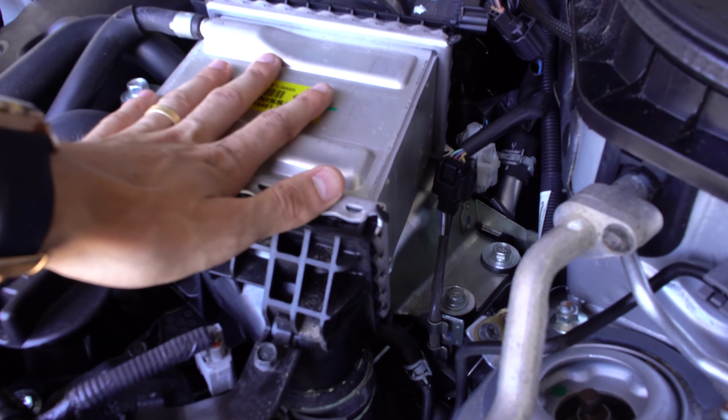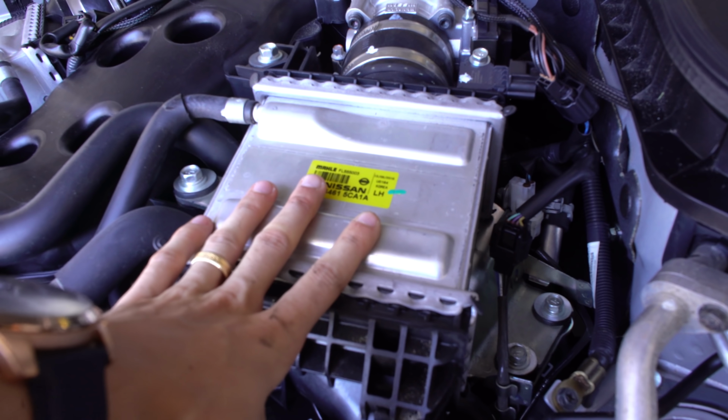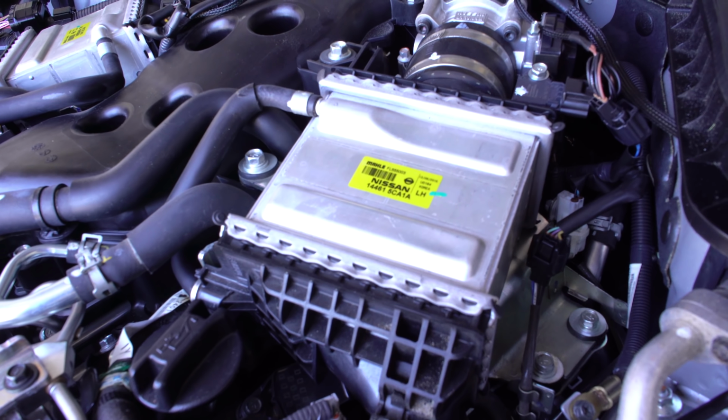So as you move, the air moves through the intercooler. Think of it like a radiator, right? It's gonna cool down that charged air. Well, up top we've got the water setup here, and there are pros and cons to this. Up front, it's gonna do a great job, but these things heat soak fairly quick, so that's a downside of going with an air-to-water setup like this.